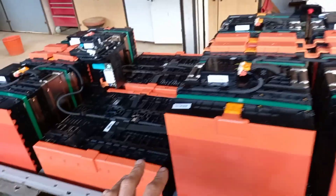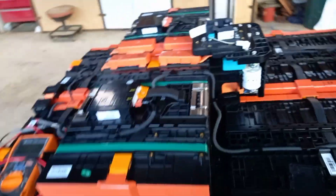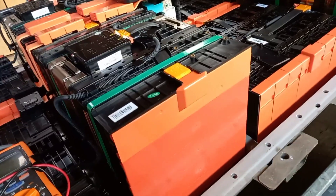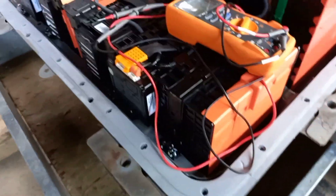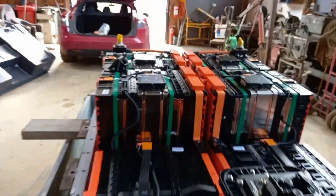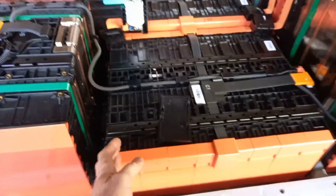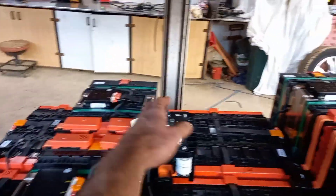These are 26 volts - one, two, three, four, five, six, seven, eight cells - let's go with that. Then there's a 33 volt group which is probably 10 cells, and then a 13 volt group which is four cells - so that'd be a large RV-style battery maybe. They're wired in series - one side is the negative pole, it comes all the way down, goes across, through here, up through the disconnect and the fuse, and out. So the disconnect is not in the middle of the pack - it's 100 volts on one section and 200 volts on the other.